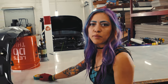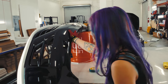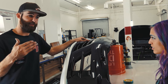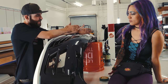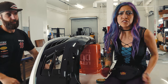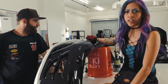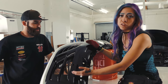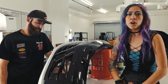So step two, same process, bigger piece. We're going to fully pull it, give it a little bit of heat, and pre-stretch it so it hugs these areas and sucks up around the bumper. If you start with no heat and then heat both sides, make sure your material is not going to fade differently — some materials are metallics and if you start in the middle tacked and then heat from one side, you're going to get a fade mark line. With matte metallics when you stretch them really far, they discolor easily — reds, yellows, sometimes blues. You've got to make sure you're not making any adhesive lines, stretch lines, or discoloring where you stretched hard, so you want a really even stretch. Keep the whole entire panel and pull it all in one go.